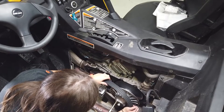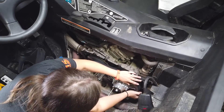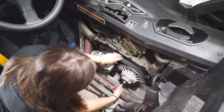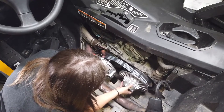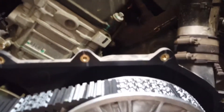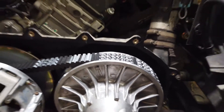Flip it over the primary first, then back onto the secondary. Remove your clutch tool and spin the secondary to get the sheaves to close. Make sure your ribs are in line with the top of your secondary — you'll know that it's back in line and tightened properly.